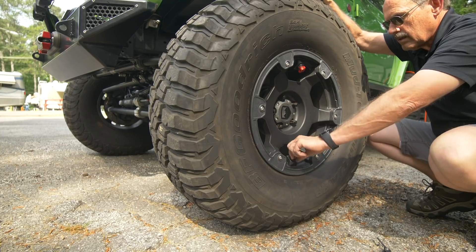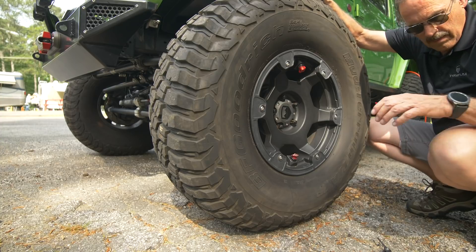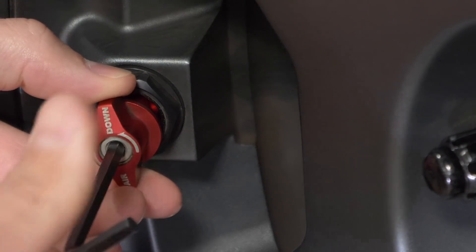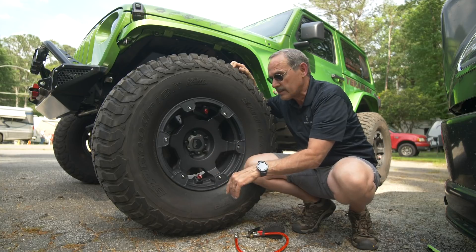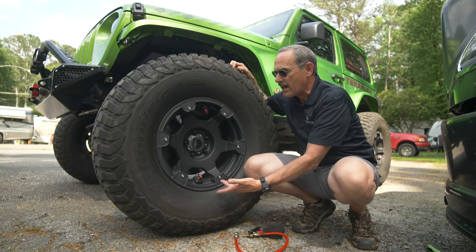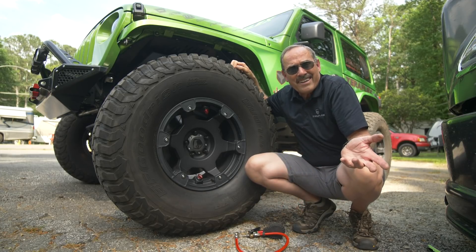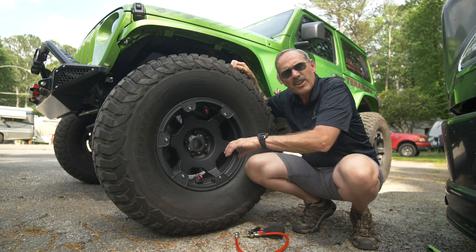If I keep the valve open until all the air has been released I'm at 13 psi, which is great for tougher trails and extreme stuff — it kind of gives me two settings in one. Now the Nomad deflator won't ever let your tire drop to zero; it'll stop at your set pressure, whether that's 13 or 15 psi. But if you leave it open while driving, every time you hit a bump or rock it'll increase the tire pressure and burp a little air out of the tire. I left mine open one day and drove the whole trail — they were down to about 8 psi by the end. No biggie, but just close them off when you're done.